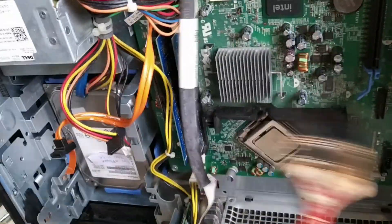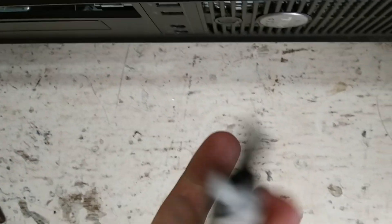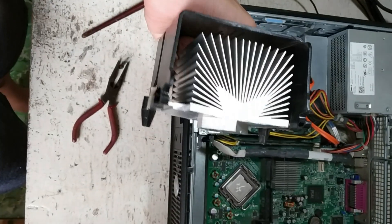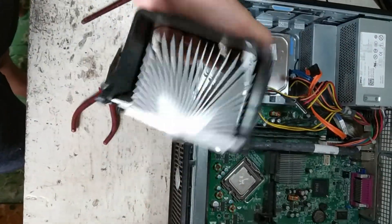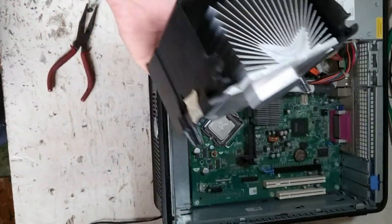So you've cleaned up the computer — it's all nice and clean, all the dust has been loosened up. We're also going to clean up the case here. So to apply thermal paste: unfortunately it seems I'm out of thermal paste right now, but provided you have the right amount, you basically want about a grain of rice worth. Then you can assemble back the black cover and the heat sink.